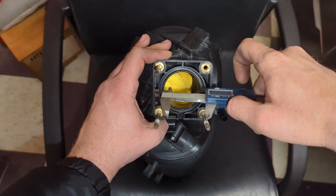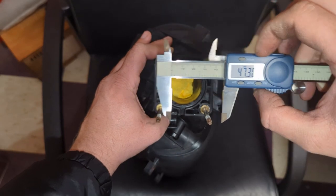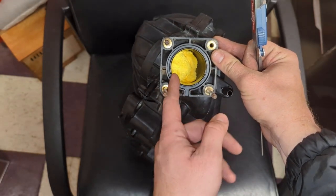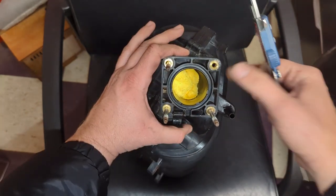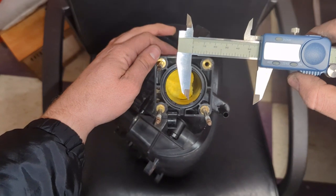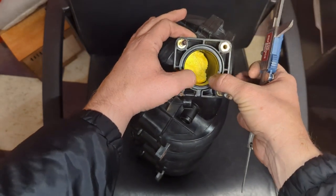So we can go ahead and open this up - wall to wall in there we have 47.3mm. Basically where the gasket would sit is in this groove here, and it goes around in the circle right up here. If we go out that far it's going to be too much for our throttle body. That puts it at 58.9mm if we bore it all the way out there.